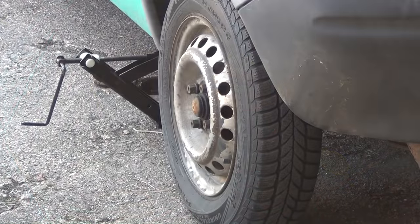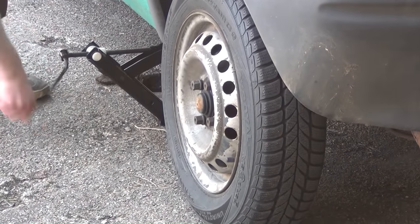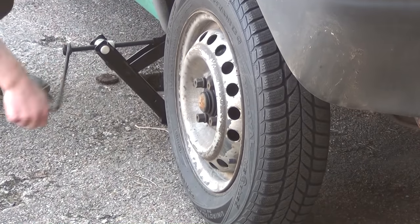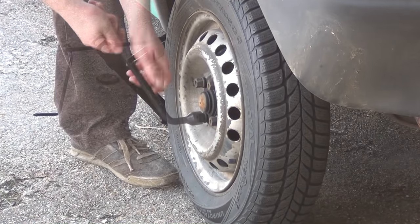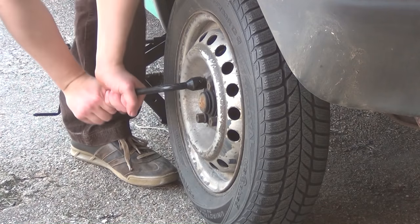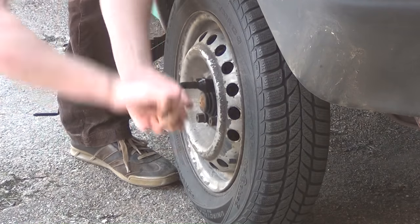With the fluids checked, it's time to change the tires. It's not a very exciting process to watch and therefore I won't cover this in detail. I place the jack under the car and relieve the wheel of most of the weight. I start to loosen the bolts while the wheel is still burdened by the car, so that it still stands firmly and doesn't spin through.